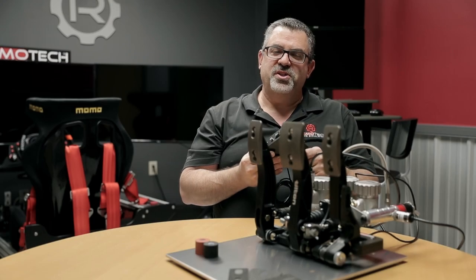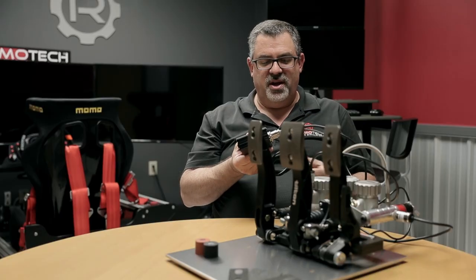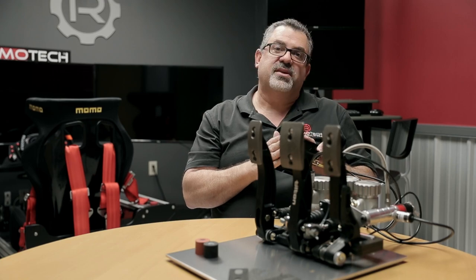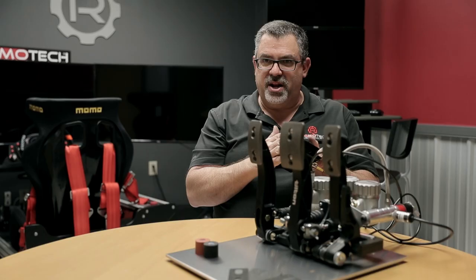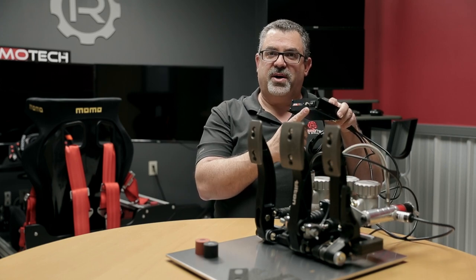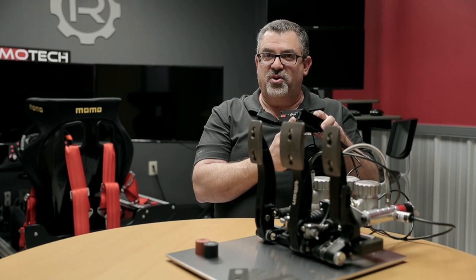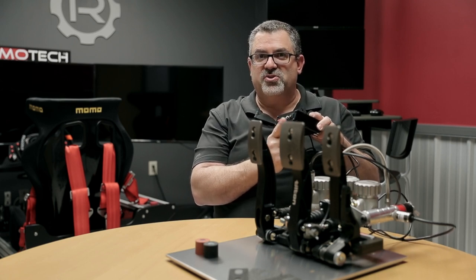When you're ready to start using the pedals, the three individual pedal cables connect to the back of the control box using the matching colors, then the USB cable can be plugged into the PC. Nothing else is needed if you're using the pedals as they come — they've already been calibrated on our test bench, so you're ready to go by just plugging them in. Be aware of the switch on the front of the box: this is a program switch, not a power switch. Don't flip it if you don't know what you're doing, as you can inadvertently enter program mode and change settings.